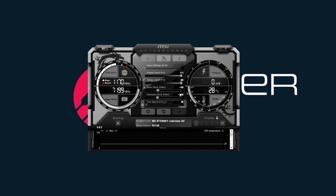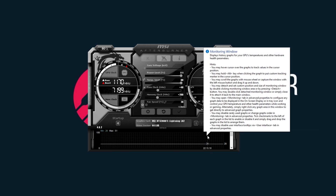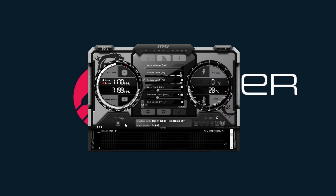Once you dial in all your settings, you can see the little save button right here. Click it and you can save up to five profiles — I'm just going to put this on number five. When you start your PC up, you can actually set it up to launch MSI Afterburner at startup too. There's a little window button that says startup, so every time your PC starts it will load this overclock automatically. I don't like doing that so I leave it off, but you can do it if you want.